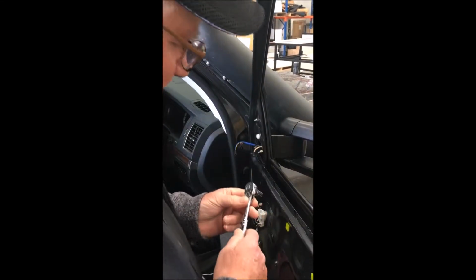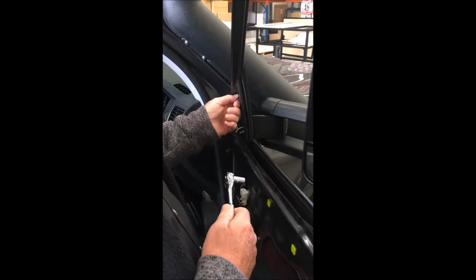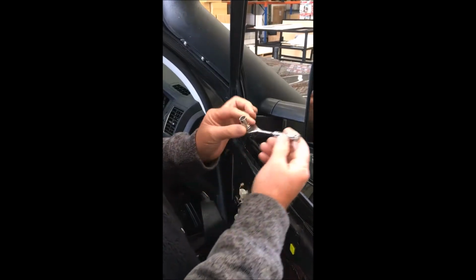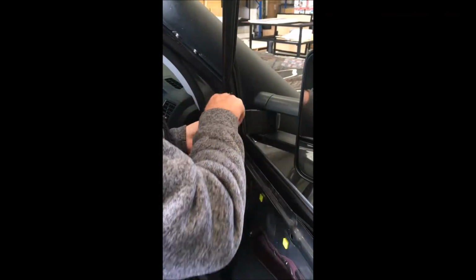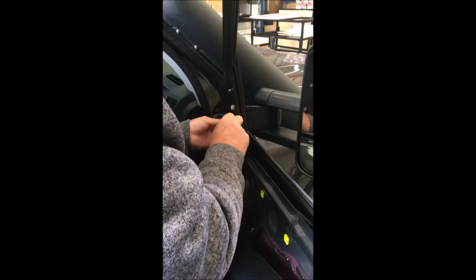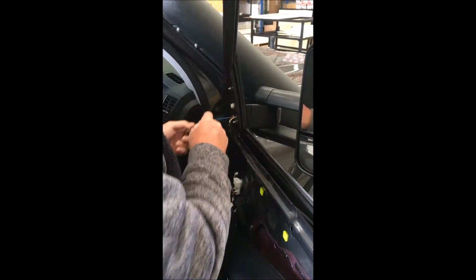I've seen so many guys use a 1/2 inch drive on these. Don't use that. You're going to break the studs for sure. I've had people do it. That's all you need. Little 1/4 drive, 10mm socket, right? And they just need to be nipped up. They don't need to be over tensioned. They'll never come undone on the car. Doesn't matter how many corrugations you go over. I've never ever had them come loose.